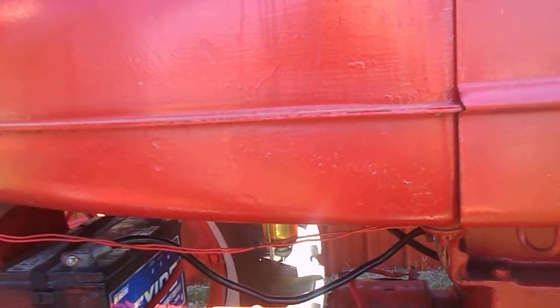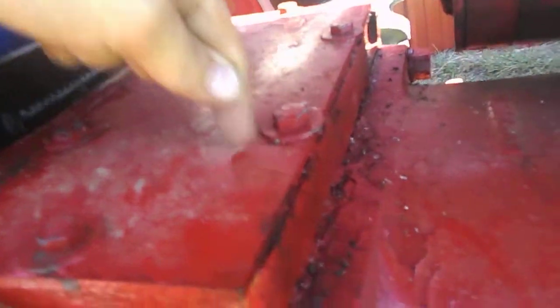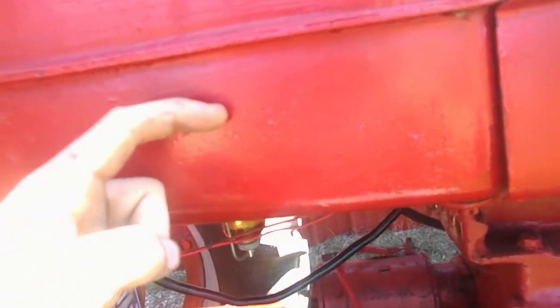And this gas tank is no good. It has a lot of rust inside this gas tank. I tried to clean it out while I was driving to school, with rocks inside the tank, and I don't really think it cleaned out much. As you can see right there, that's a lot of rust that goes in here. This used to be clogged all the time, but then I welded a small aluminum pipe that would go straight up. So I had to make sure it's above, like, up to here, up to a couple quarters, or else it'll run out of gas faster. Just to stop the rust from clogging that up.